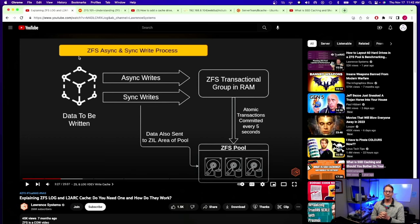The idea of a cache drive is that your most frequently read or written information goes to the cache drive first, and then is dumped off into your hard drives later. Basically it's a copy, or you can have what's called a mover, where data is copied here and then later moved there. My whole idea from the start was to get this system to be as fast as possible.